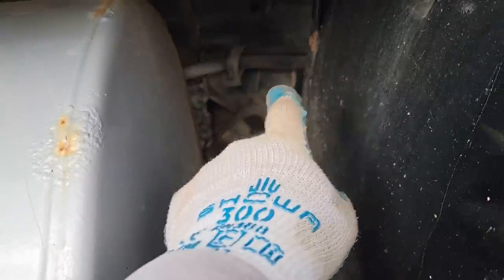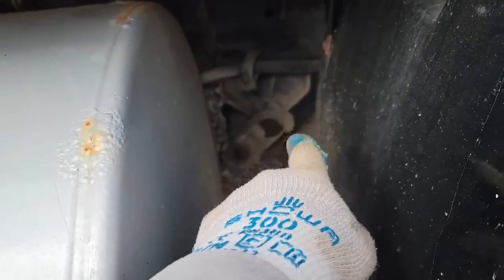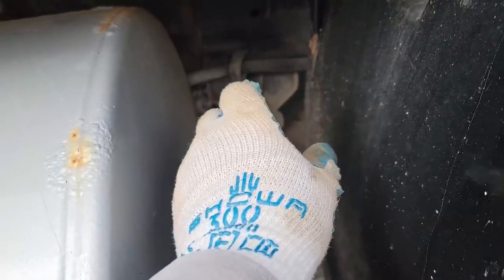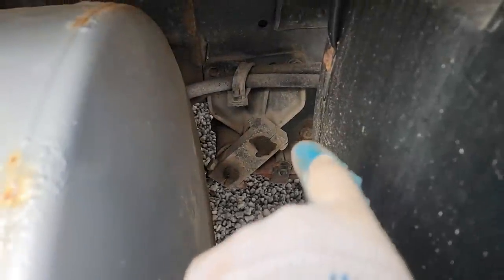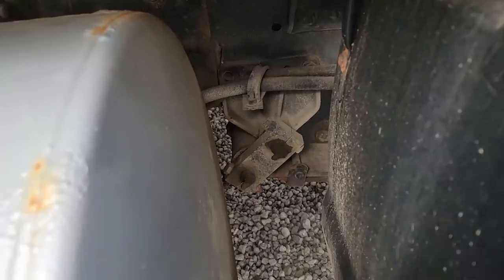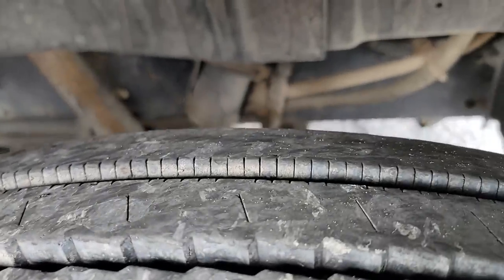So it doesn't look like it's hitting that leaf spring mount. But the leaf spring mount is what can wear, because the shackle, one on each side, you can see they have a squeeze bolt that holds a bolt in place and it turns in the hanger. So there's a possibility that hanger's worn, maybe not. It moves a lot right there. The front doesn't move as much because it's only got a small amount of travel. As you can imagine, just going up, it's pretty small. The rear has far more travel than the front.